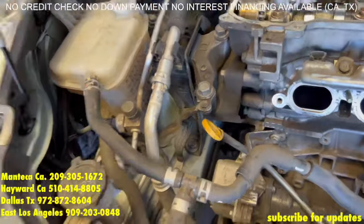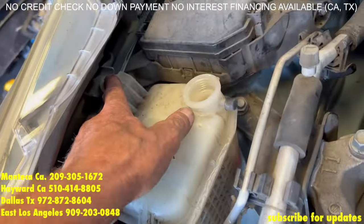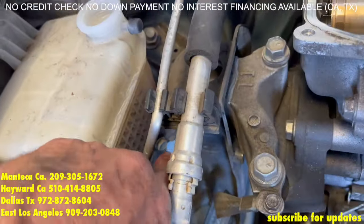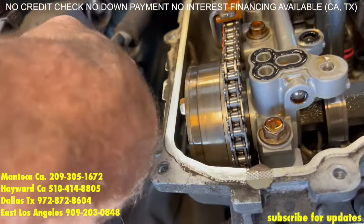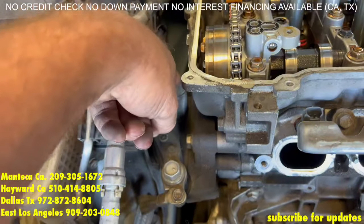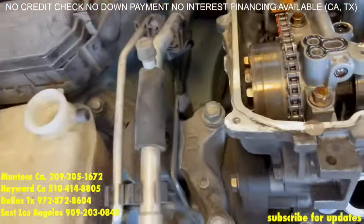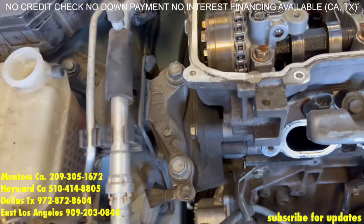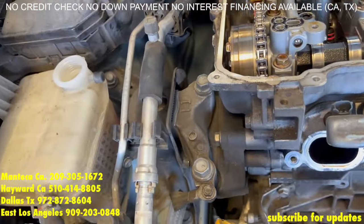While he is doing the ones down there, we have the 10mm ground, we also have the 10mm right there that we are taking off, and you have the 10mm bolt right here — and you are going to take off this right there. Once those are out of the way, then you have 17mm bolts and nuts holding on the engine mount. I recommend using a small jack to hold up the engine so it doesn't go down too far. But once you get all these bolts off, you're going to be able to pull the engine mount out.